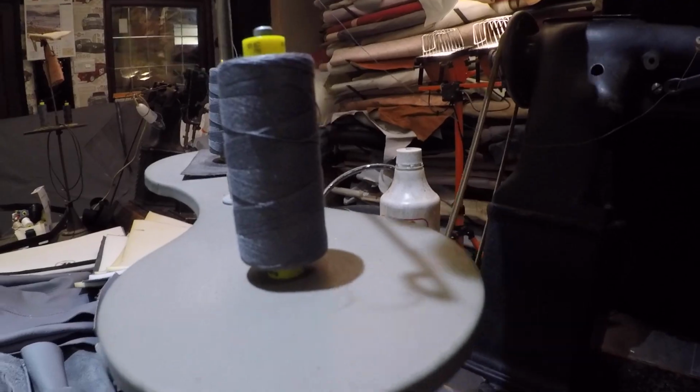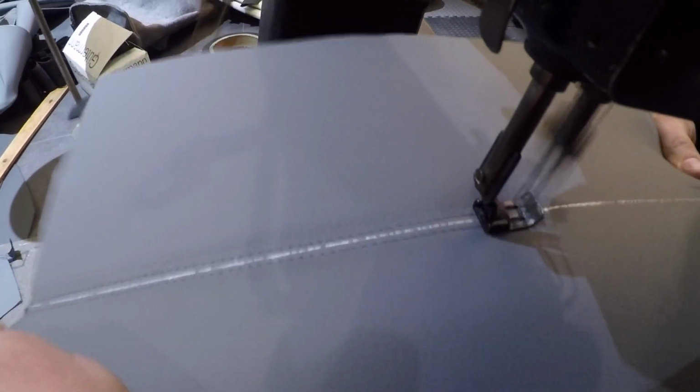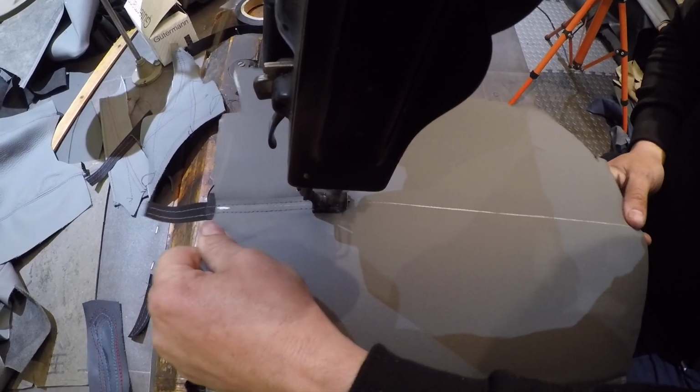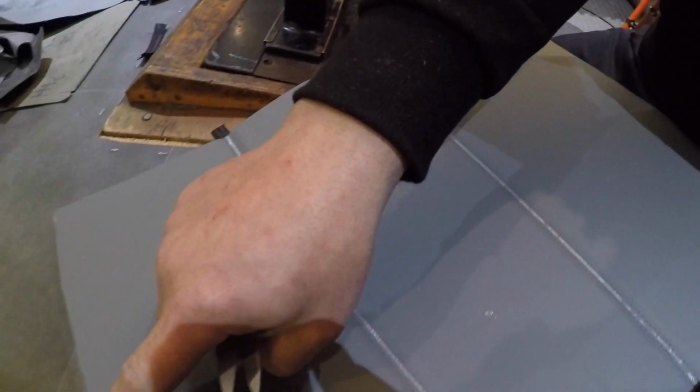We are stitching the top stitch of the seating panels. These comprise a twin row of stitching, in this case using the same colour thread as the leather. These rows of stitching serve as a decorative design, but also to hold the hollow tapes on the underside which attach the covers to the relevant tug points, creating the shape of the seat.